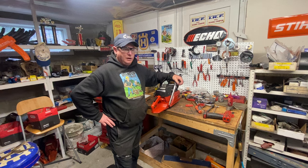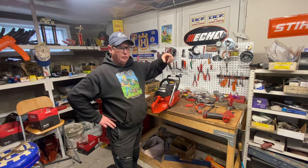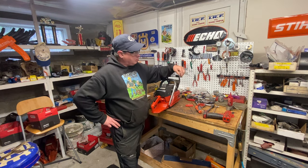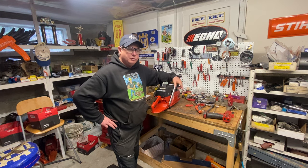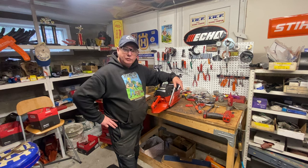First race I got out there, passed a few guys that crashed, and then my cart started running really crappy. Inside the gas tank on these carts, you have your fuel line with a little bob weight on the bottom that moves around to get your fuel. I looked at that hose the day before and thought it was flexible enough — but it was actually a bit rotten. I should have changed it. Could have, should have — I tell everyone else to check stuff like that, but I missed it.